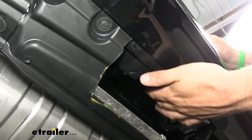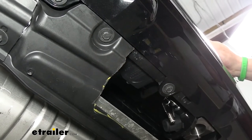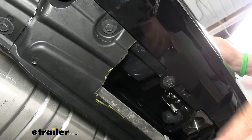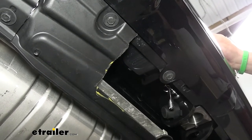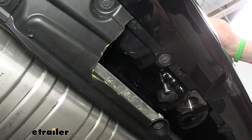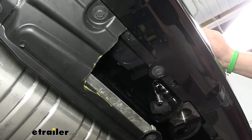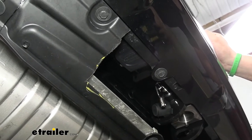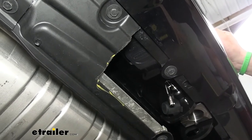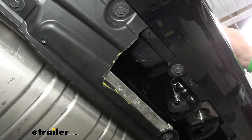On the driver's side of our latching mechanism, you're going to see a seven-way trailer connector. If you opted for the towing kit, it comes with the seven-way as well as a four-way adapter, so you can tow any trailer with a seven-way or four-way, covering the vast majority of trailers on the market. This kit also comes with a powered wiring harness, so you don't have to pull lights from the vehicle, and everything has circuit protection so the trailer won't affect your vehicle's lights.